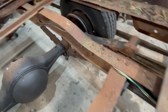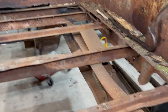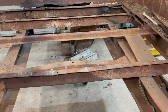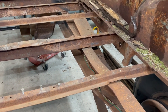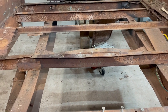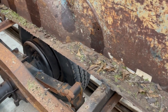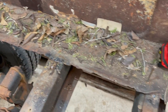This bed appears to be missing something in comparison to a US bed: the skid plates. There should be two in the back on the rear Z channels and some up front. The ones up front look like skid plates but they're longer than I'm used to seeing — I don't know if that's a difference between US and Canadian beds. What the skid plates do is reinforce the bed where it mounts to the frame.